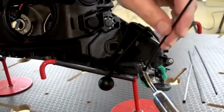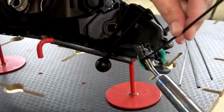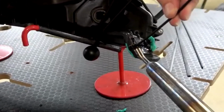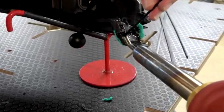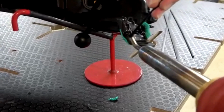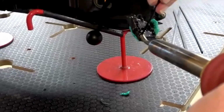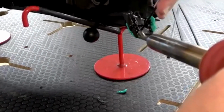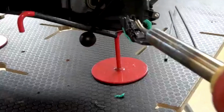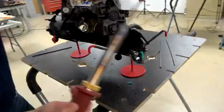But very important though, during this process, to make sure you melt both the base material and the rod, right, John? Yes, it is. Yes, sir. Make sure both those plastics are melted at the same time. Yep. The angle of the welder and angle of your welding rod plays part in that. So yes, if you do not get both plastics melted as they're joining together, you will not have as strong and effective weld as you could. Your tab can end up breaking off on you.